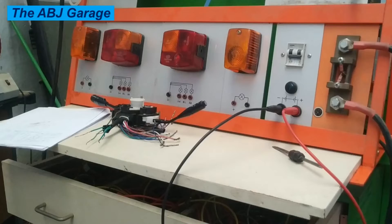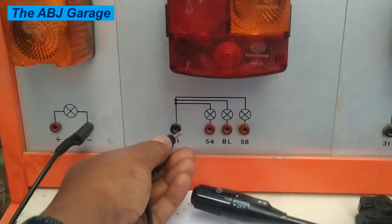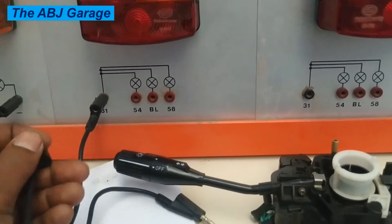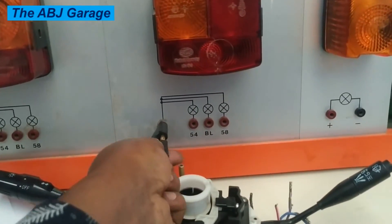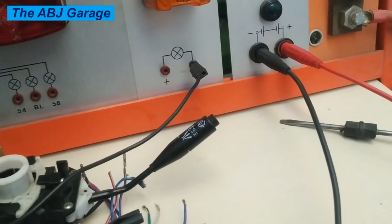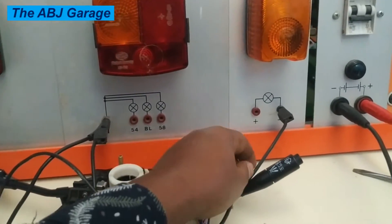Let's do the connection. Let's begin our circuit construction by connecting all the ground terminals to one line. We will be doing a parallel connection. This is a ground line for the left. Let's connect it to this ground line — terminal 31 represents the battery negative line. They are all ground lines. Let's connect it to this line, and finally we will be connecting this line to battery negative. The negative terminal of all four turn signals here are connected in parallel, and we will finally connect this line to battery negative.